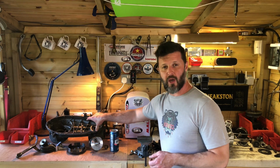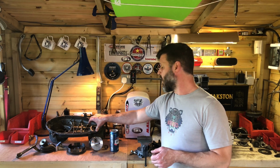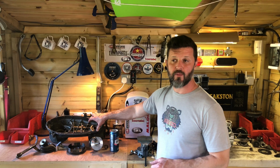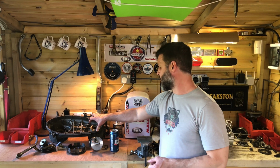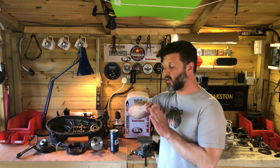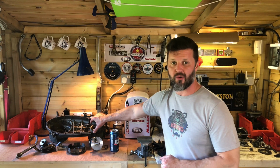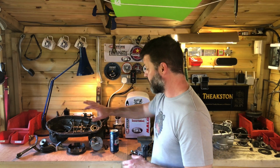And then I'll probably go with either a 26 or maybe a 28 mil Dell'Orto with a BGM Clubman, I'm thinking. So maybe hoping to touch the high teens, 20 horsepower area with the kit and the pipe and the carb combo. Set it up so it's got a nice linear power delivery. So quite a pleasant ride, nothing crazy or out there in terms of power figures for that engine anyway.